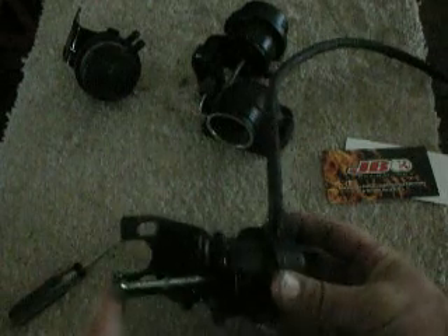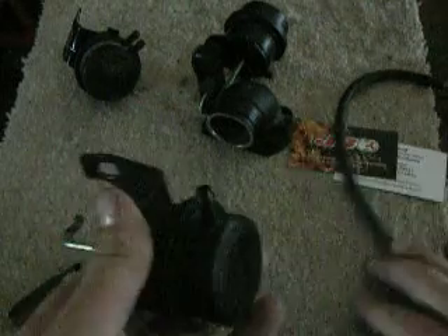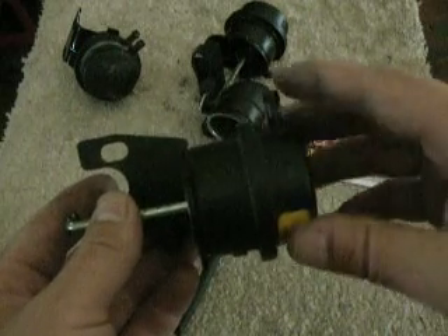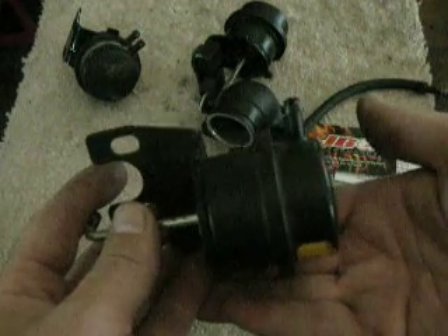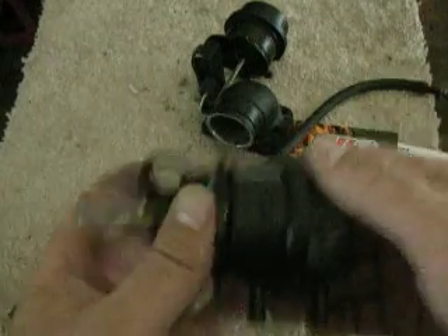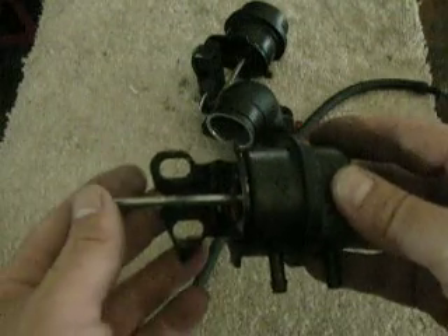A key to helping you replace these is sometimes there's a VA number stamped down in here — you just look for the right VA number. You look at the shape of the bracket and the shape of the lever, whether it's towards the bracket or away from the bracket. Another thing that can change is how many ports. It's not really important how many ports are on there, but where is the port in relation to the bracket, because there might be clearance issues. If you've got an intake down here and something here, it's critical that this piece be pointing up instead of down — placement of this can be critical if you don't have good clearance.